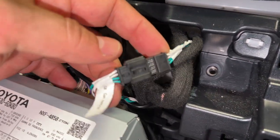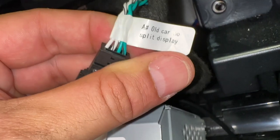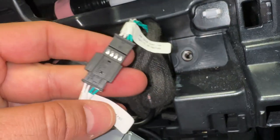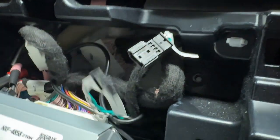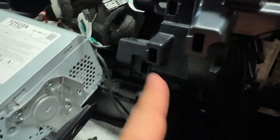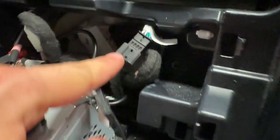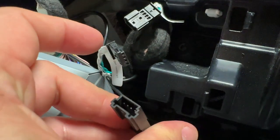Pulled the radio forward. You want to locate this connector — the label on it says 'my old car, no split display, CAN control.' Pull this little connector out from here. Now, before I go routing this other cable through all this stuff, I'm going to plug it into this one. The big side I'm going to leave unplugged — I don't think that needs to be plugged in. I'm just guessing here, so follow along.